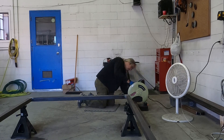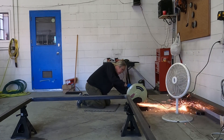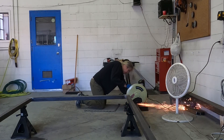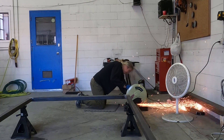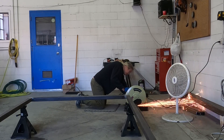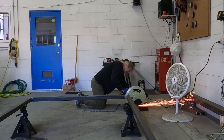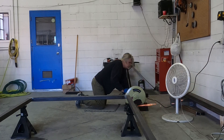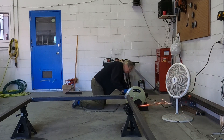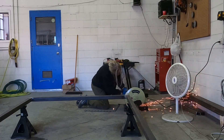In this clip I'm cutting out the cross member. I then have to grind it back a little bit because I always cut them a little bit long. I'm going to grind the edges back to 45 degrees, enough so that the weld can bead into the area that I open up with the grinder. I'm not going to show you a video of me welding them in because it'd be a waste of your time.